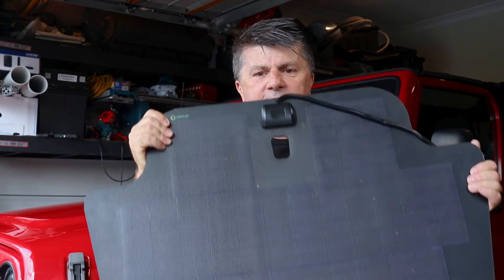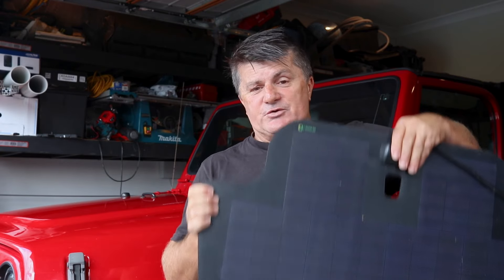What I can hear a lot of you guys saying is that the bonnets of these get quite hot, and as we all know, solar panels when they get hot their efficiency gets less. Well, if the bonnet's hot, it's probably because the engine's running and I'm getting charged from the alternator, which is far, far more charge than what I'll ever get from this thing. So I'm not really concerned about that. But when this thing's parked up, it will work quite well — that's the theory anyway.